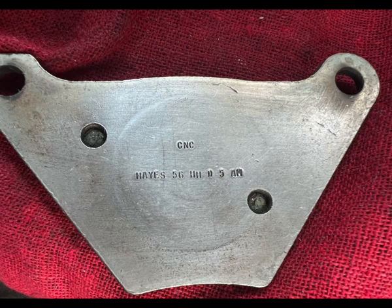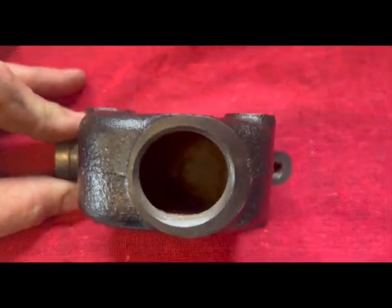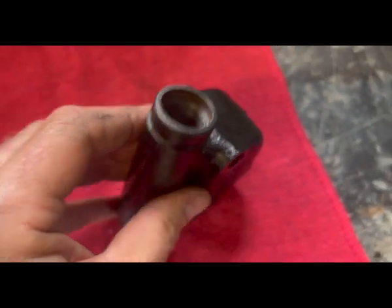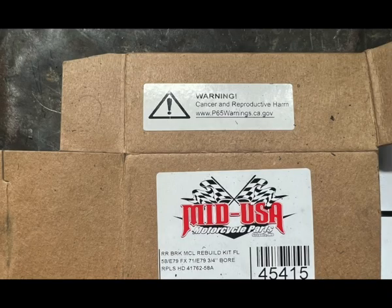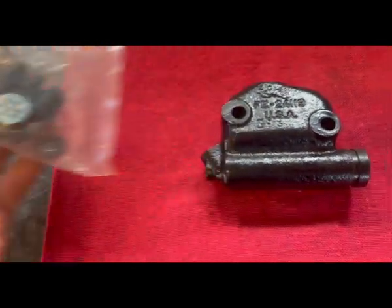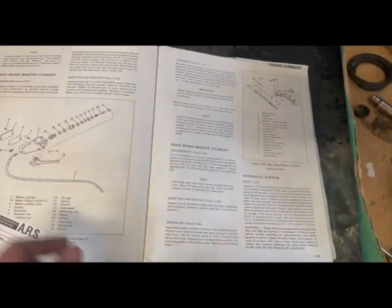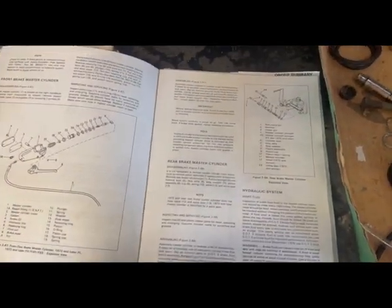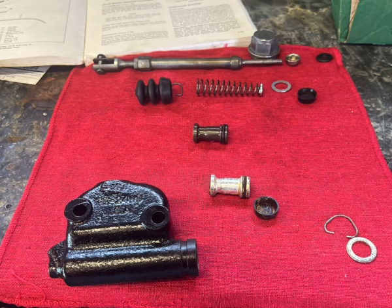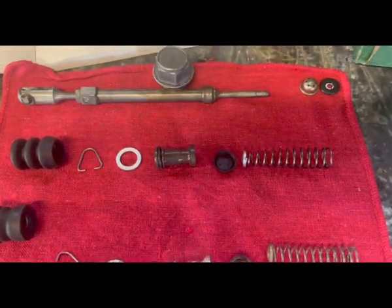You can tell by looking at these brake pads — they were like brand new there. Here's the master cylinder. The master cylinder was in actually very nice shape. I took it apart, cleaned it real good inside and outside. Gave it a coat of paint, let it dry out in the sun real good. Make it look nice and clean, ready to go. Here's the rebuild kit for the master cylinder — got it from the local JP, I think Dennis Kirk, somebody like that. But again, that's the original Wagner Lockheed one there. Here's the owner's manual, here's the assembly manual. Always refer to the assembly manual if you can't remember how to put something back together. Here it is laying there on the cloth with new parts — the old parts on the bottom, the new parts on the top.